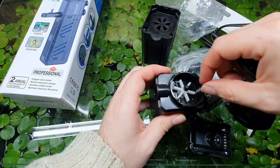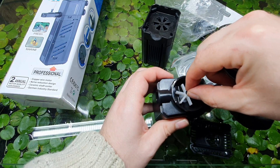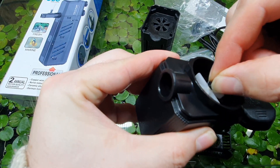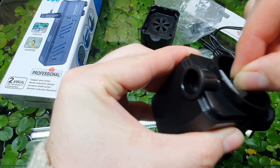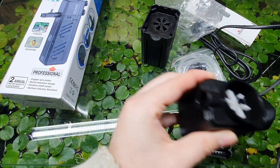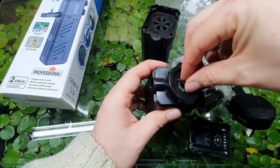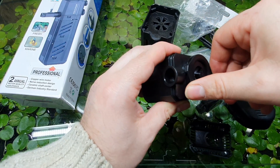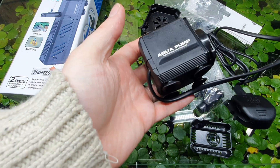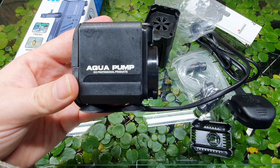Like we see in all these kinds of pumps, it's a dual-direction motor — basically when it turns on it can go either direction. And we have lots and lots of play — you can hear that — that's how much play from left to right we have. That very loose fit will certainly cause problems in the future, with the impeller either snapping the shaft or creating loads of noise.